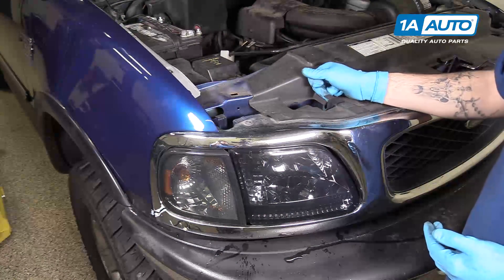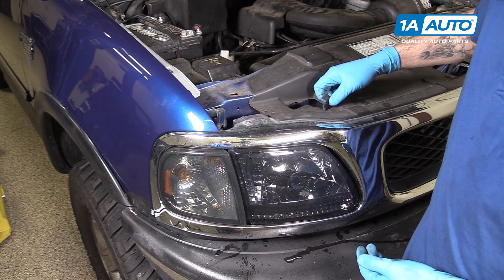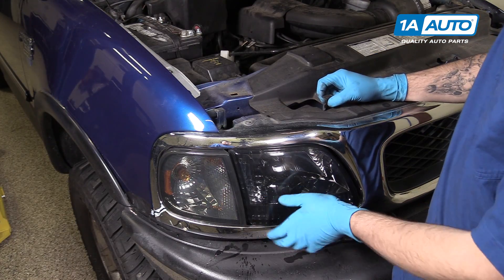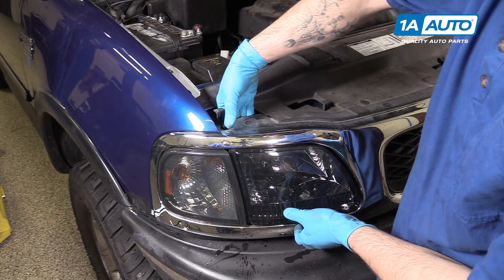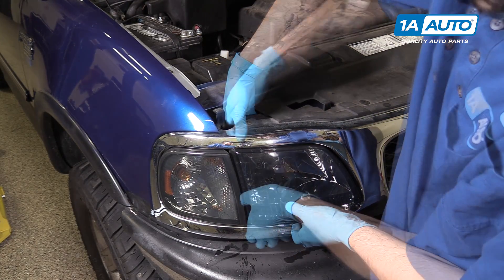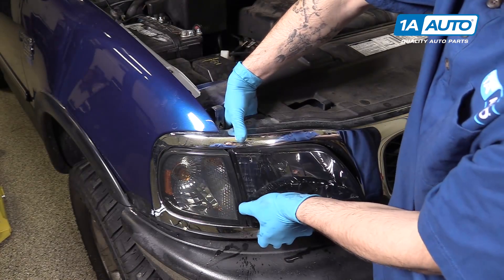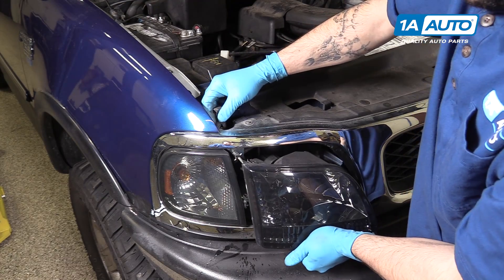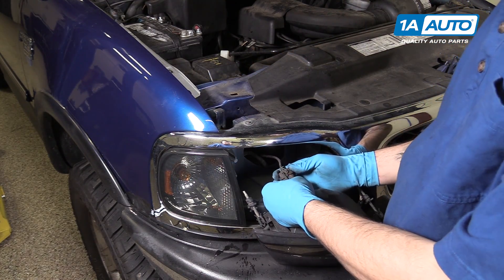Here are the items you'll need for this repair. To remove your headlight, lift up on the two tabs behind it. Sometimes you've got to wiggle them a little to get them to stay in place. Work your headlight out — you may be able to reach in from the back and push on it. You've got to make sure these tabs are fully disengaged. Over time, they wear out and they tend to get a little stuck. Once that's out, you can unclip your headlight harness and remove it.